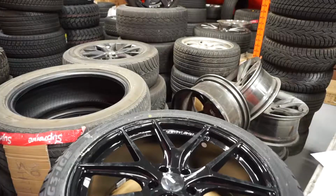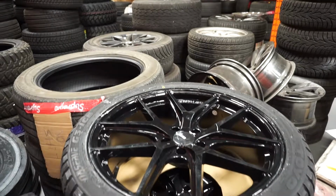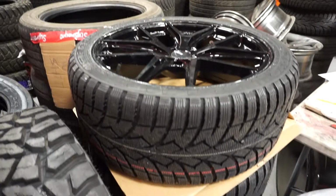If you don't want to be switching your tires on and off between the same rim, I highly recommend you get yourself a pair of steelies for the winter. That way, when it comes to switching your tires, all you have to do is take the lugs off and put the new rims on. That's a lot cheaper than having your tires swapped off the same rim, so in the long run you'll save money as well. However, if you don't like the look of steelies, you could also get a cheap pair of alloy rims for the winter, so you still have a little bit of style, but you don't have an expensive pair of wheels on your car being torn to shreds in the winter.